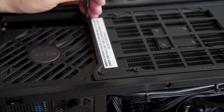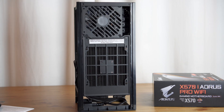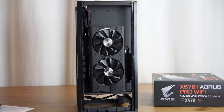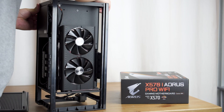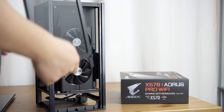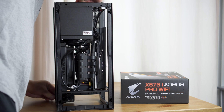I tried using other people's config files to get things going — same motherboard, same GPU, same CPU, so I figured it should work. I tried that two or three times and at the end of the day it didn't really work. It would boot up but nothing else worked. So I went to the vanilla OpenCore guide and just followed it step by step, built my own image, and got everything up and running.